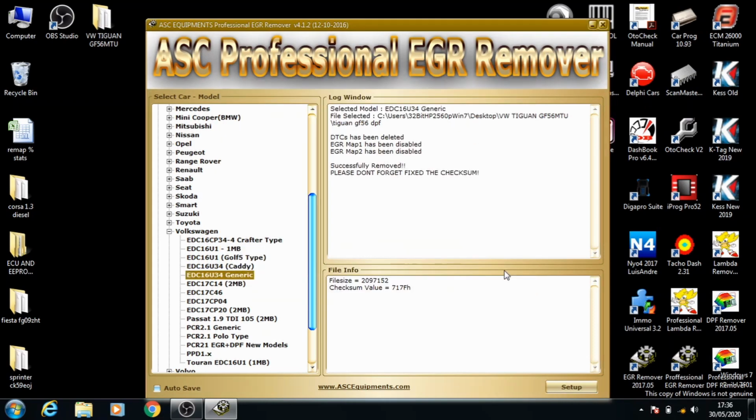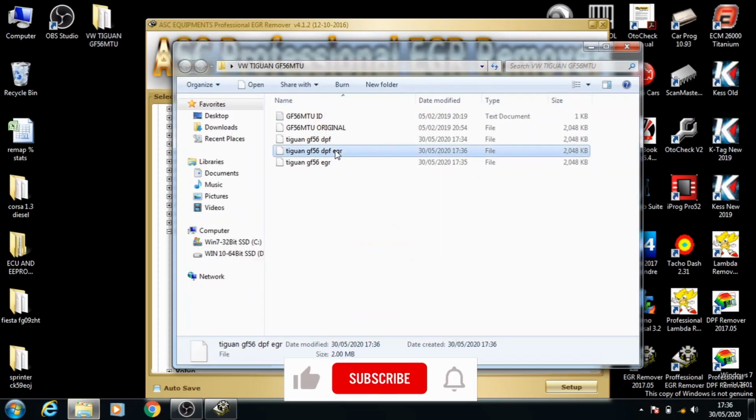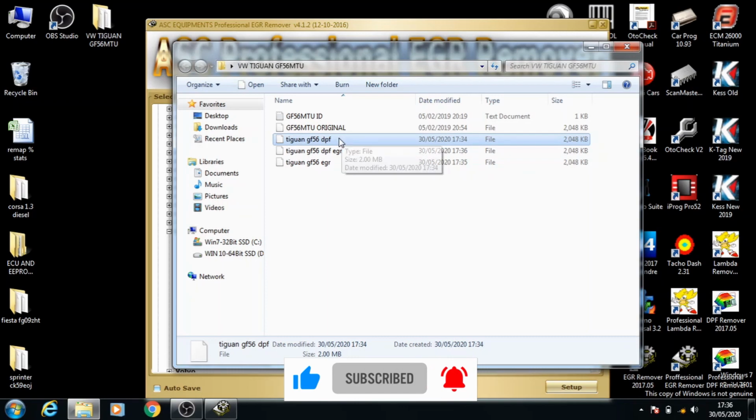So this file would have both of them removed, and there's the file. There's the EGR only, and that's the DPF with the EGR, where we amended this file and took out the EGR map after the DPF map was already removed.